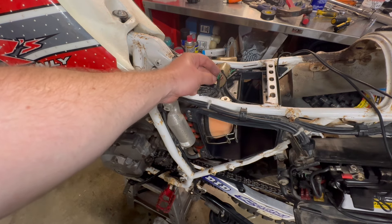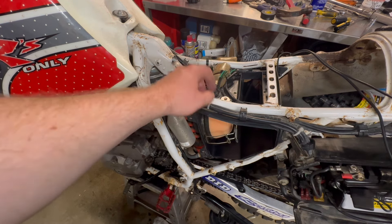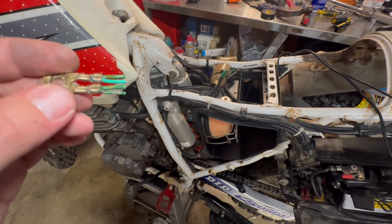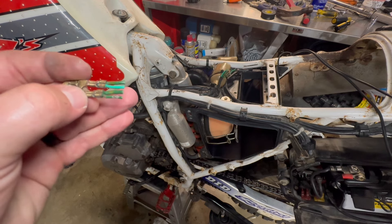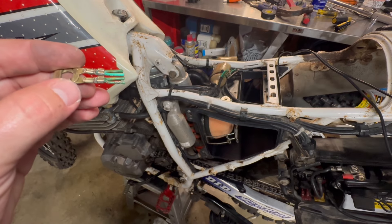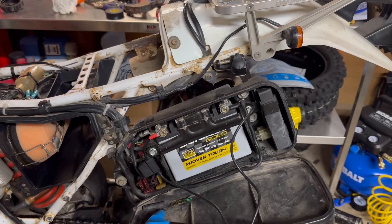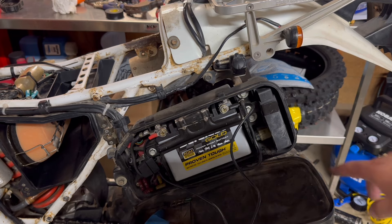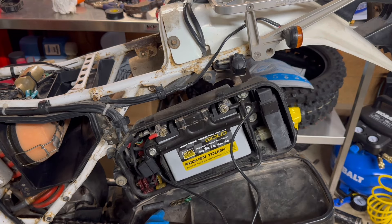The ground's been a pain in the butt, so I snipped off the ends with the connector. You can see the one closest to the camera has some pieces missing from the insulation, so I'll put a new connector on, crimp those up, and see if we can get some spark. I redid the ground and that wasn't the problem. So I resorted to just hitting stuff — after whacking the CDI box a couple of times I got spark back. I think we've chalked it up to the CDI starting to go bad, so we'll order one. In the meantime, we'll see if we can't get this thing started.